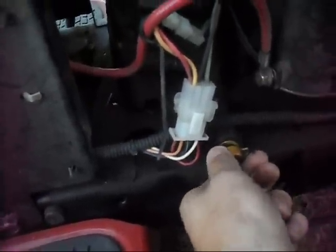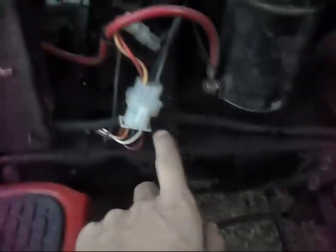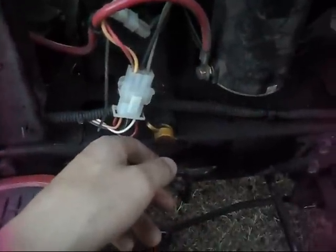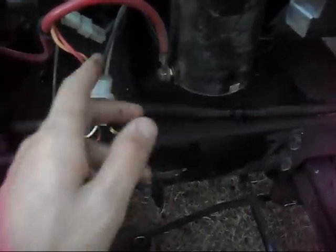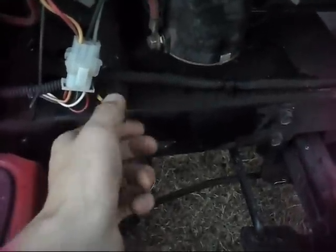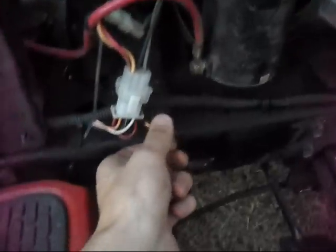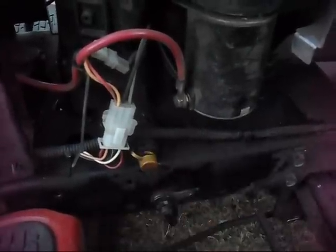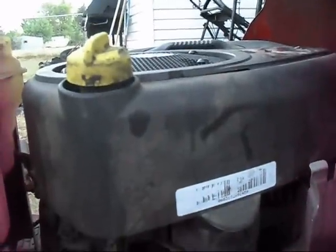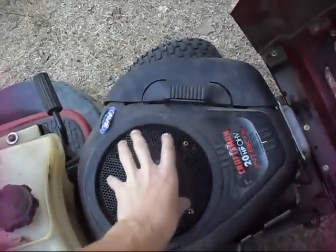Threw a rod. And this little culprit down here is one of these easy-leak-all-your-oil-out plugs. I'm just not a big fan of these things. I had another Craftsman in there that had one — the guy ran low on oil and developed a rod knock. This plug is what caused this engine to throw a rod: the owner went out and mowed, this thing was leaking all the oil out of the crankcase, and next thing you know it threw a rod. That 17 horse Briggs on the shop floor is what's going on this.